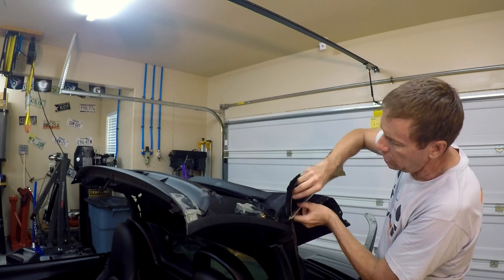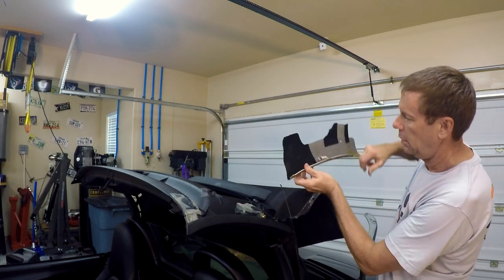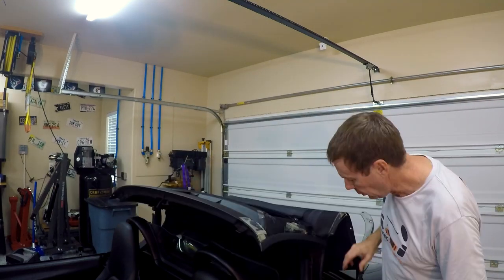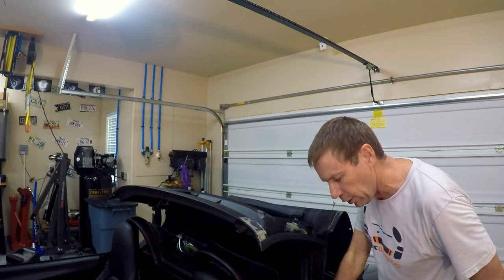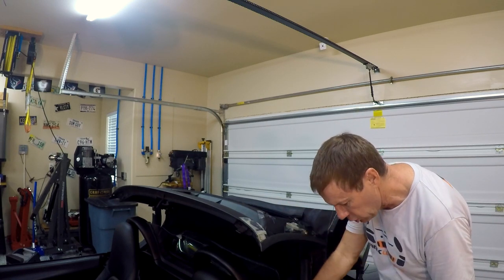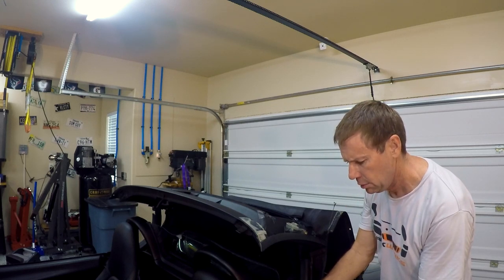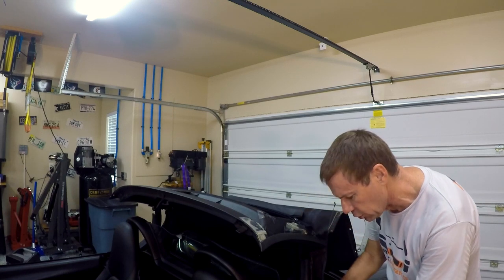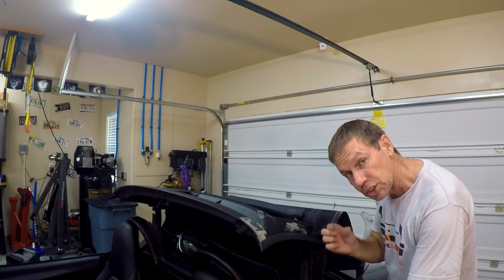Then that wire — there's a slot at the end of the plate — it just slides right out of that slot. That plate's ready to be cleaned up for reuse. Next, there is a screw. You follow this cable down and there's a screw in here. You may have to tip your convertible top back a little so that you can get your screwdriver in there. It's a T25. Get your T25 on there. There's a screw and then another end that looks similar with a star lock washer.